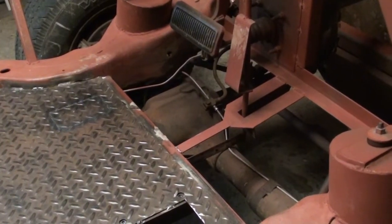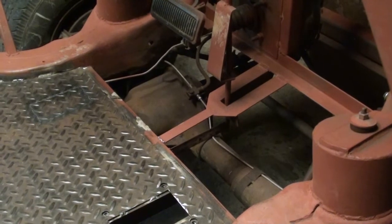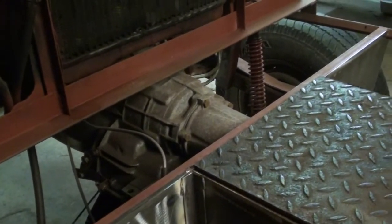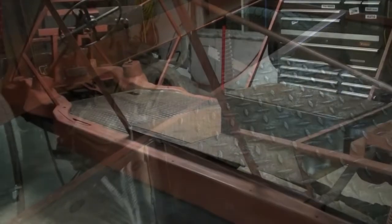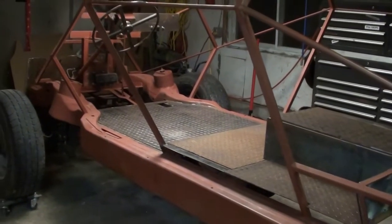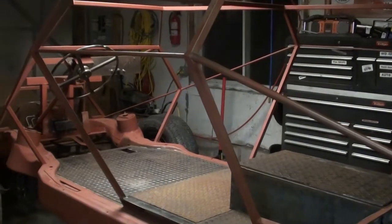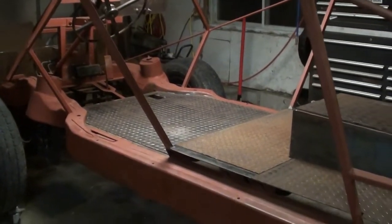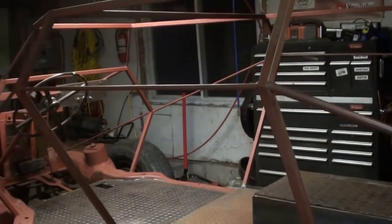So all that's really left is this front section — I'm debating on doing that with the thicker tread plate I have or maybe just using some 14 or 16 gauge steel to close that in. There's also the back section over top of the transmission that needs to get closed in. But aside from that, the floors are completely done. I still haven't decided if I'm going to move on to working on the exhaust or start using some of the material I have and start working on the actual body panels. Talking with my son and strategizing — we're thinking we're going to do these center panels first and then move forward and backward from the middle. There are really four segments: the top section and then the larger bottom section on both sides, basically just rectangles, super easy to cut out and put in place.